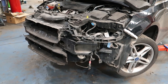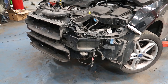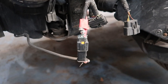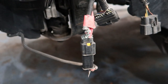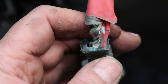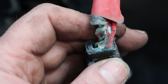We've got the front bumper off. It did show signs that the vehicle has had some sort of impact at some point — one of the headlights is broken and there are a few self-tappers and cable ties here and there. On removing the bumper, the first thing I noticed was this multi-plug just dangling, not secured to anything, with a little bit of red tape — not genuine factory tape — and you can see some green corrosion going on just there.